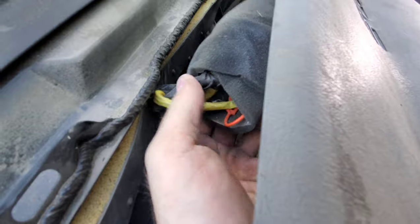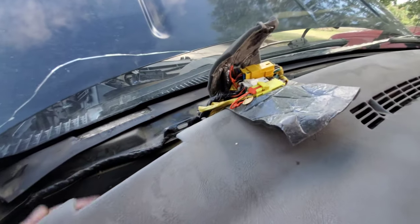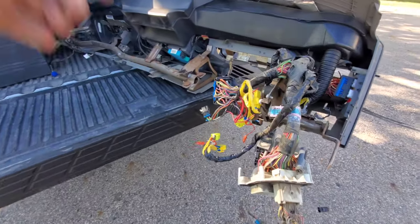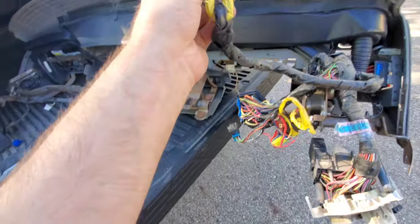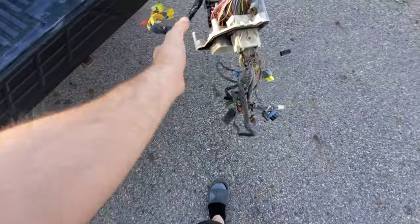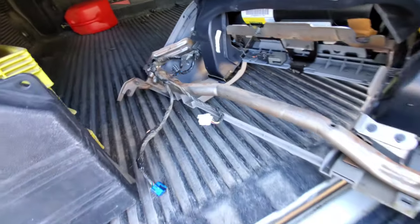The last of the wiring is back in here in the center up top — there's a whole bundle of airbag stuff with three plugs, and I believe that's all the wiring to take the dash out. This is for the steering column, this is all the dash wiring, this goes in the engine bay, and this is on the firewall. Here are the plugs that are in behind where the airbag sits.